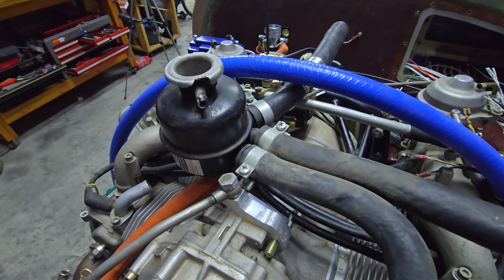This is the old-style collector — on the new one, this boss here is angled more in this direction and the rear boss is more to the rear, which would probably help me. I don't know why Rotax designed it this way — having this port pointing at sensitive electronics seems pretty poor design. They should have had it pointed toward the rear where the collector bottle is. Maybe the new collector solves some of that, but it's still pointing at the electronics and coolant pump. The U-shape hose goes down into where the radiators sit.